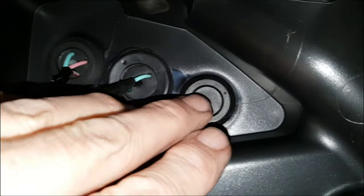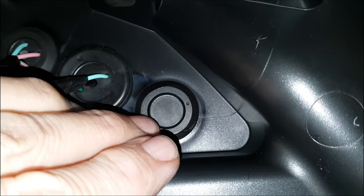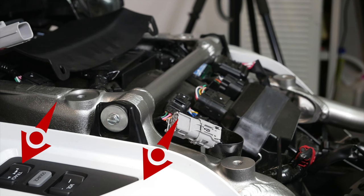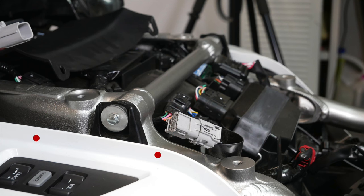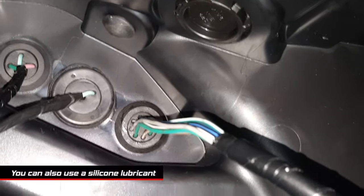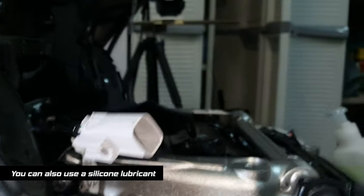This is the plug that you have to remove. After you remove this rubber plug, you can then pull the Homelink wiring harness through the opening. You'll also need to remove this 8mm bolt and washer, which will allow you to pull the saddlebag away from the frame and give you enough room to work that Homelink harness down and through the opening where you removed the plug. Now we've got the plug pulled through — you have to soap it up with some dishwashing soap and pull it through from the back side. You start back here and pull from underneath, working your hand from up top, pushing that plug as you pull until it comes through and seals. You want to make sure it's sealed — you don't want anything leaking in your saddlebag. Now we can plug this into the Homelink.